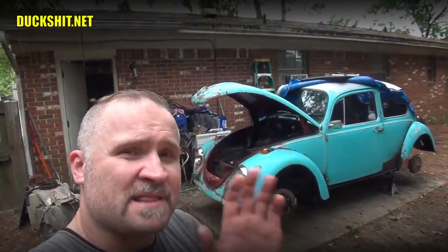There's about three different methods that I can think of. There's two active methods and there's one passive method, and I'm kind of an active guy, so we're going to go with the active ones. The active ones consist of either pumping that brake and having somebody release the valve, or pumping it with a vacuum pump and sucking the air out of the line. And the third one, which is the passive way, is just open the valves and let the fluid flow through, but that takes too long. And I'm not one that likes to wait. I'm somebody that likes to see progress immediately on this type of job. So we're going to go with the active methods, and I'm going to demonstrate both of them in this video.